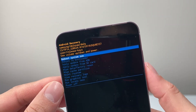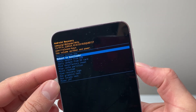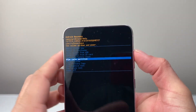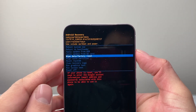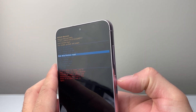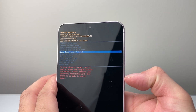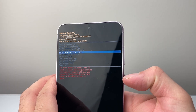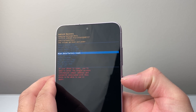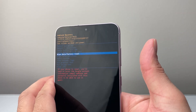It's going to boot up into the Android recovery menu. In the menu you'll see multiple options — you're going to use volume up and down to navigate. I'm going to use volume down to go all the way down to the section that says wipe data and factory reset. From there, you're going to press the power button, which will go ahead and factory reset your phone. Keep in mind, if you use this method, you'll need to sign in to your Google account if you had it signed in, after you do that reset.